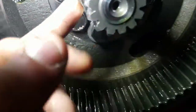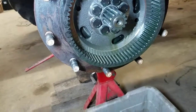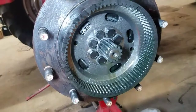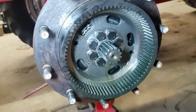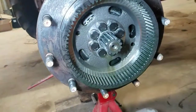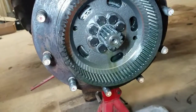Right now we got to get this inner gear out. There should be a snap ring way back in here that I'll try to take a better picture of. I got to turn the wheel all the way to one side and then hopefully I can get that snap ring out. I believe I showed in a different video the modified snap ring pliers that I made myself with a torch - we're gonna need to use that, probably, like I had to do for the Case 215 I've done before. This looks pretty similar design, so let me work on that.